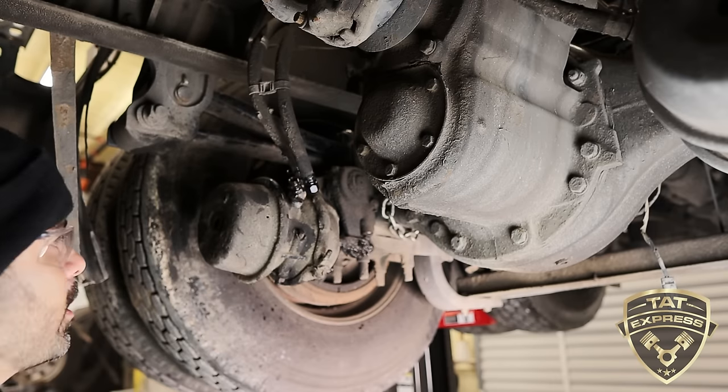your new brake chamber, this is not the right one. This is actually a long stroke brake chamber. This is not the one you're going to be using. This is a short stroke. Remember how we mentioned the roundness on the connection? That's how you can tell you have the right brake chamber. This is not the correct brake chamber, but this is just for demonstration purposes.